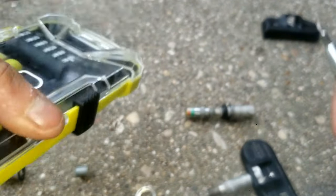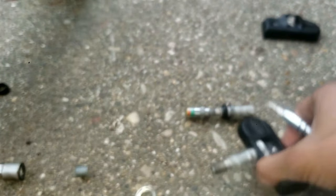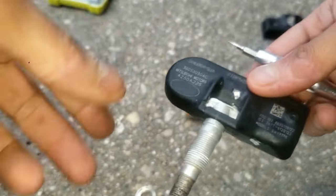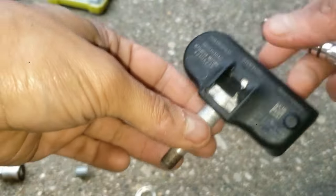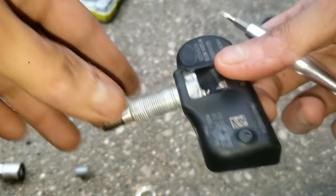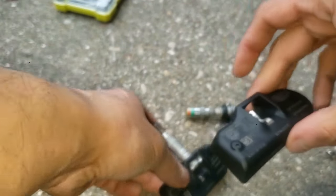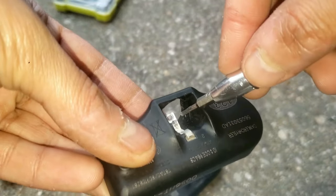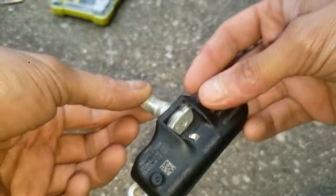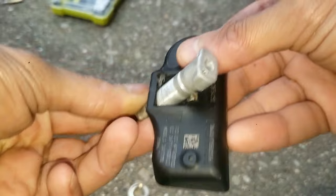If you do this yourself, make sure you get one of these smartphone repair toolkits — they have the small bits you need to get these kinds of screws out. That's actually another excuse mechanics use; they just don't carry these, surprisingly, and that's another way to get you to buy a new TPMS rather than just replacing the valve stem. So stay one step ahead and have a smartphone repair toolkit. I'll put this in the description. Now I'm going to use the T6 bit to remove the screw. Once it's loose, grab a small flat-tip screwdriver and carefully bend the flap up. Then wiggle the stem out and up.